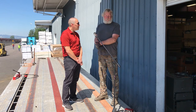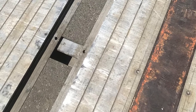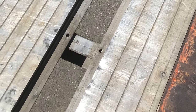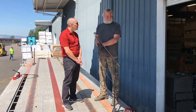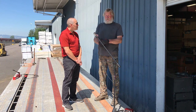The first thing is make sure you get all the old screws from the old flooring flush with your stringers, so that the Apatong and the aluminum product — whatever trailer you're working with — sucks down to those. You don't want to use the old holes. Well, sometimes you have to, but that gets real tricky. You want to put new holes in there and get a nice tight grip.